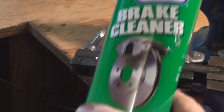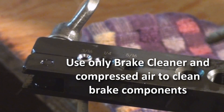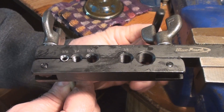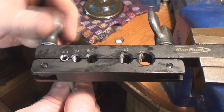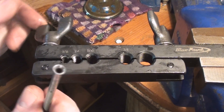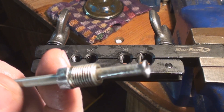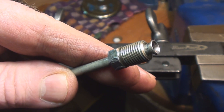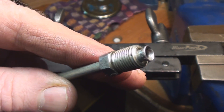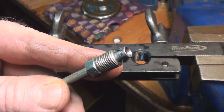That's what it'll look like. I'm just going to clean that up with a little brake cleaner and some compressed air. Pull that free and you can see I've got my flare nut on the end — there's the finished product. Double flared with the flare nut on it. And that's a standard double flare.